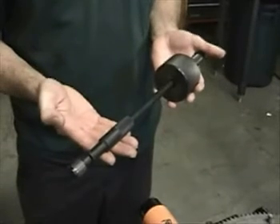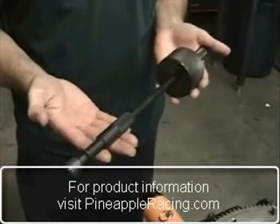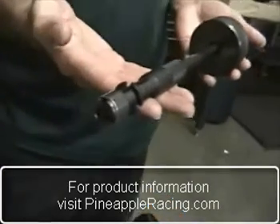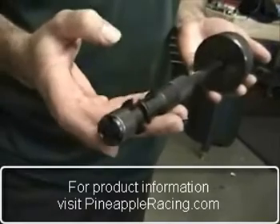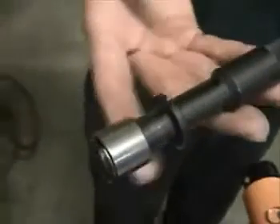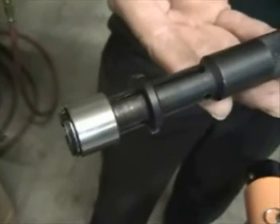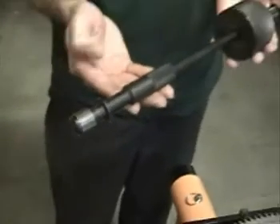This is a factory pilot bearing puller — by far the best tool. Most of the aftermarket two-jaw pullers don't work very well. This particular tool has three jaws and does a wonderful job of grabbing the pilot bearing so that you can pull it out. It takes a substantial amount of force to remove that bearing, and the two-jaw pullers just deflect and pull right through without removing the bearing.